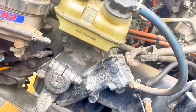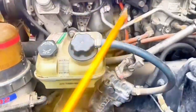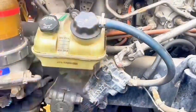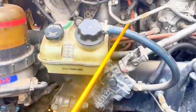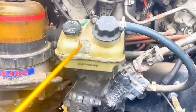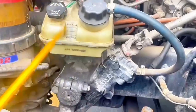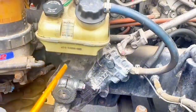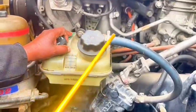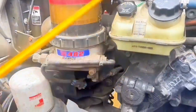Suspension system, sorry, we left this one. Now, this is called steering hose. Steering hose, no cut, no leak. Clamps must be tight. Power steering, no damage, no leak, no missing bolt. Cap must be tight, proper level, securely mount.